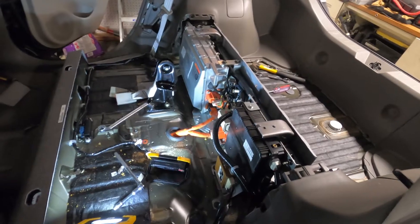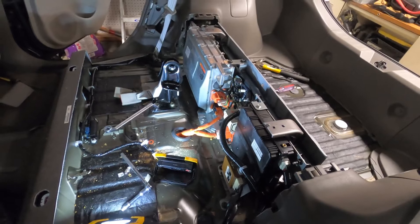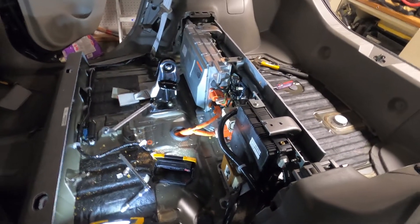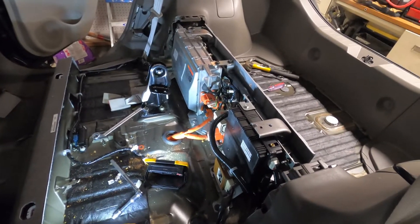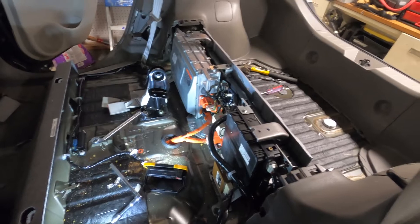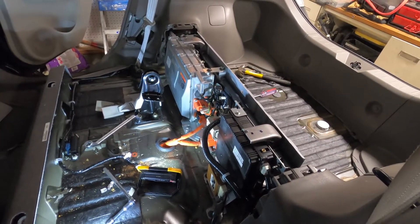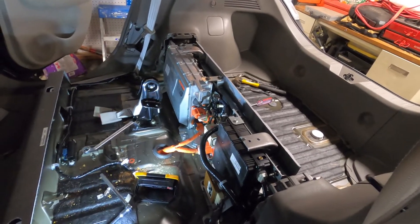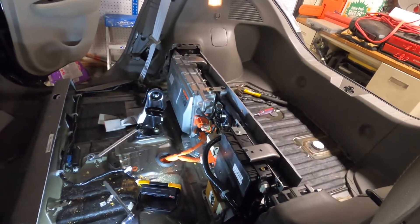The offending piece is that unit right there — that's what we've got to take out. Now that we're done with the easy stuff, we've got to go through the discharge process, get the coolant drained, and get the hoses out from underneath. While it's going through the discharge process, we'll do that job. By the time we're done, that 10 minutes should be well expired, and we can start disconnecting all the high voltage stuff and unbolting it.